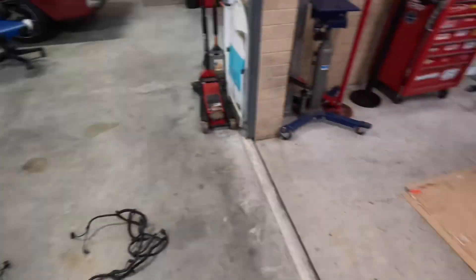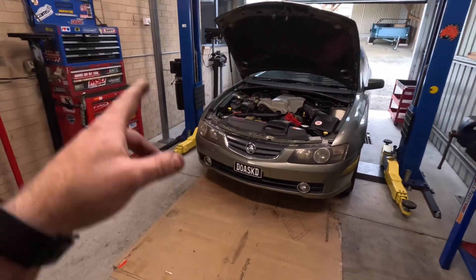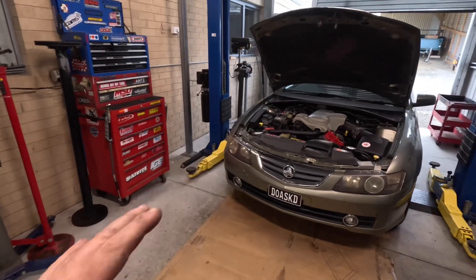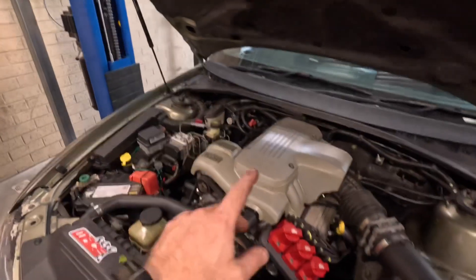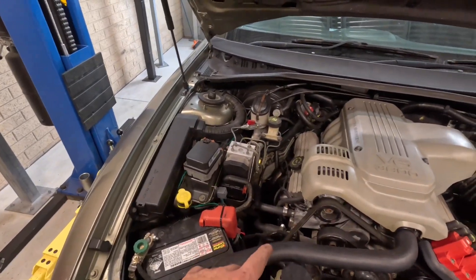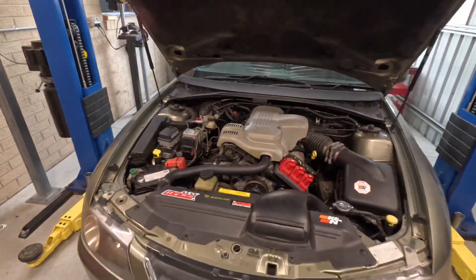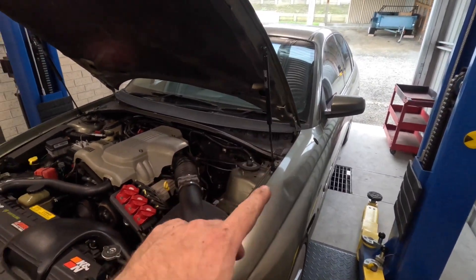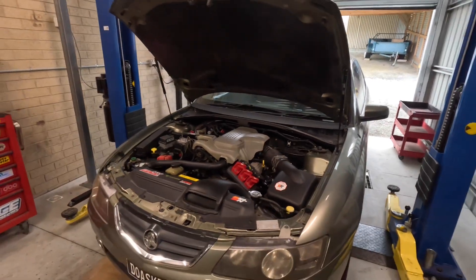I think it should start on the auto ECU with the manual harness. The reason is you do have to link the ECU with the body control module for the car to start, and there's a bit of stuff around that - don't know if I'll have time for that today, but we'll see. Basically what we're going to do is get the engine cover off, get the belt off, get the alternator off so we can access the wiring, get the car up and undo all the transmission wiring, and get the passenger kick panel out, get the ECU unplugged and start feeding all the wiring out from under the dash.